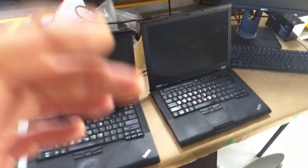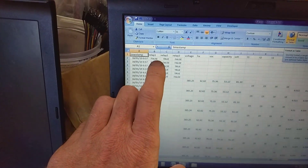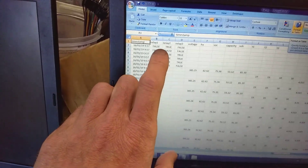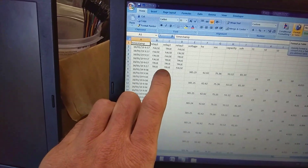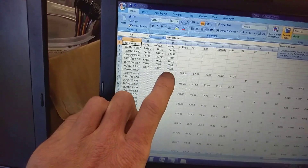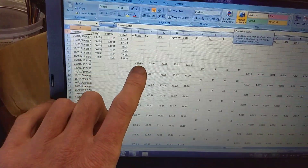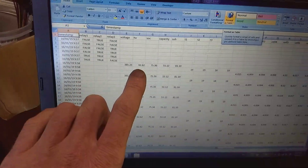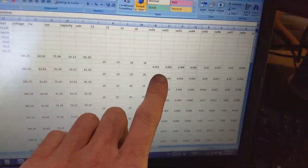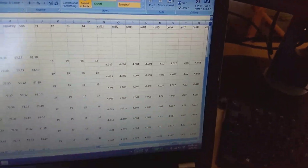For an example of what it's doing at the moment — it's listening — so if a relay goes on or off, there we go, on or off. This is the sequence where it connects the battery in, and you end up with the two main relays on and the pre-charge off. Then we've got battery overall voltage, state of health, capacity, charge, and then voltages of each of the cells all the way across there.